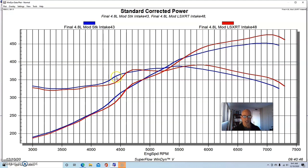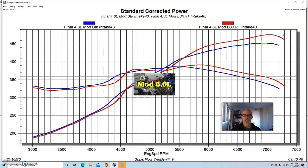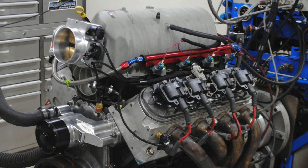Looking at the power curves, the truck manifold made a little more in some areas — about 16 or 17 foot-pounds more in one spot. Below 4,200 RPM they were similar, with a slight dip on the FAST around mid-range. But from 5,500 RPM out past 7,000 RPM the FAST manifold was quite a bit better, even on a 4.8 — probably the worst combination for it given the small displacement versus the manifold's airflow capability. If it works on a 4.8, it's definitely going to work on the other combinations.